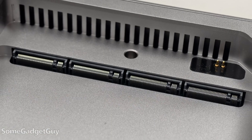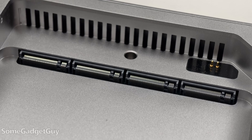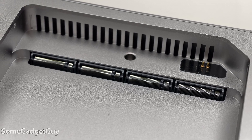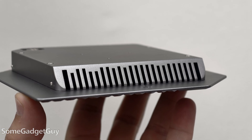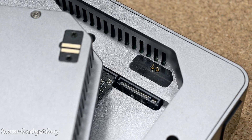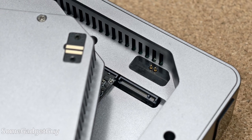I love doing this live. It's the same tool-less manufacturing on display. This is a solid aluminum frame and it just pops right open. Then we're greeted with four slots for NVMe SSDs, and Acasis includes thermal pads for your drives should you need them. The fan is built right into the door — just like the 2-Bay — where we don't have a clumsy ribbon cable to power it. Two pins on the frame make contact with the door when you close the enclosure to power the fan. It's so clean.